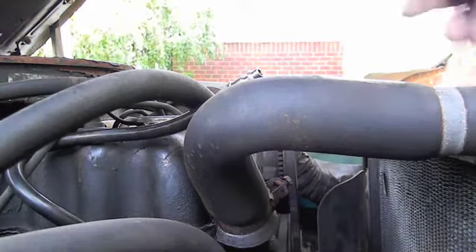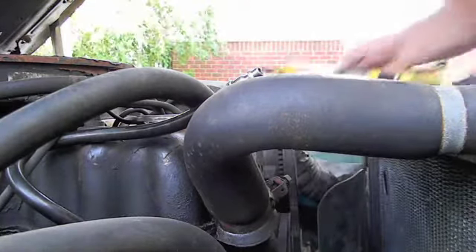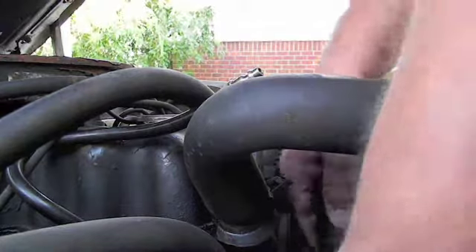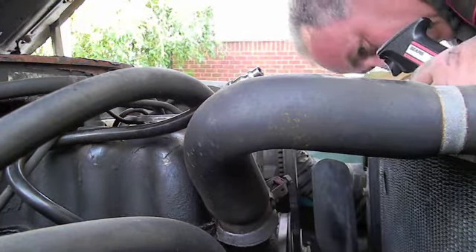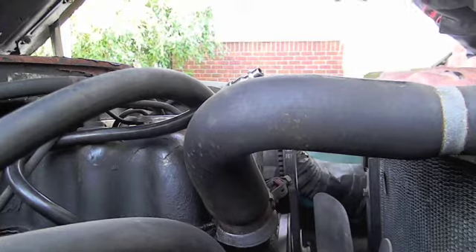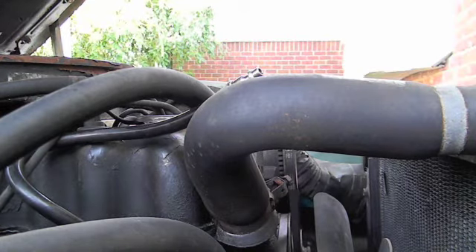I started to get pressure — now from this point on I can do it by hand. You can actually grab the fan and turn it the same way. I don't even need to put my hand on the tube anymore because I know what's coming up. Let's see where we land — I can see my numbers down there, just got to see the mark. You can hear it coming out. We are at two degrees advanced right now.